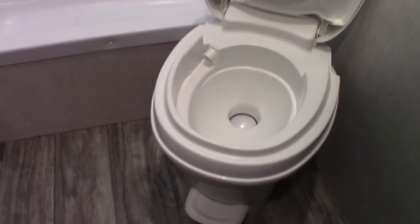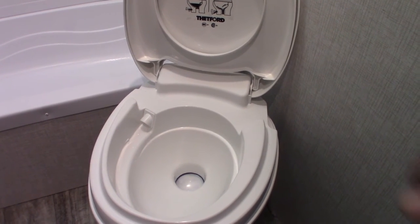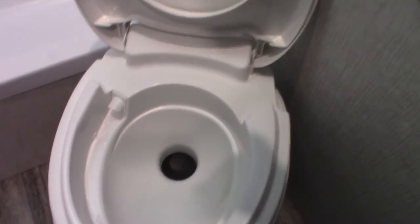The bathroom works like any other bathroom when it comes to the sink and shower. You should always run the fan with the shower to pull the humidity out. The important thing to know about RV toilets is you can't use them dry without chemical — the black tank is directly below. When you pull into the campsite, level your trailer, hook up the water and power, then come in here with your chemical, step on the pedal, let water swirl around, and put about a gallon of water and chemical in the tank. You can't use it dry because the smell will be very bad and it can also get clogged up.